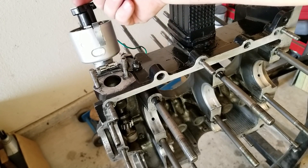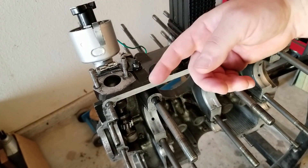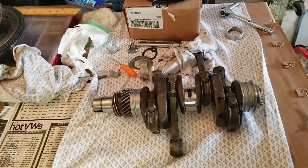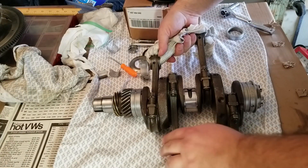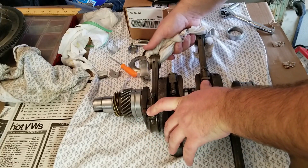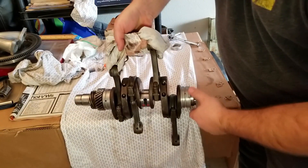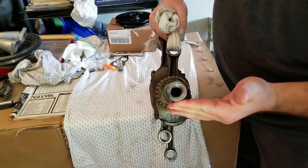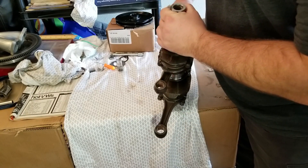This is where you need to have your distributor rotor and the housing all lined up with the slot before you go to set your crank into position. When you set your crank into position you want to have the number one rod pointing up — top dead center position. What I use is a rag here to help me set the crank down in place. This rag acts as a handle so that your number one and number two rods are pointing up. On the front of your crank where your woodruff key is going to go, this should be pointing down towards the ground as you're dropping in the crank. That's something you want to pay attention to as well.